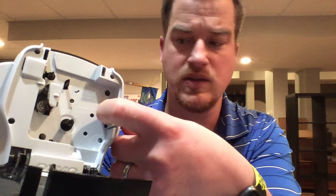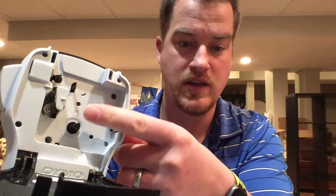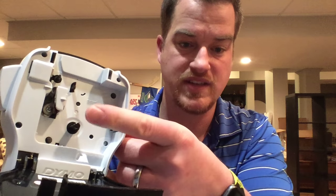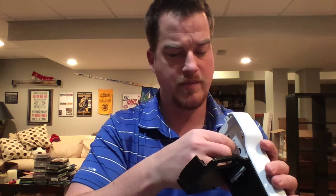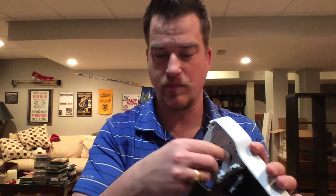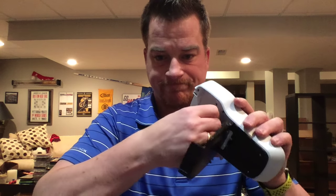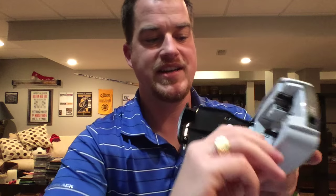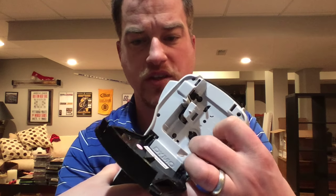Once you press it with the batteries in, you don't actually need to turn it on. So you just press it. If I press this down, this should turn — every time I press it, it should turn a hair. So if it doesn't turn, what you do next is take your hand on the spindle. You turn it clockwise five times, and it's really hard. If you need a pair of pliers, gently turn it, but I recommend using your finger because you don't want to damage the teeth on here. You physically turn it — you're not going to break it. You hear the motor in there kind of going. Turn it five times. When I touch the little tooth thing right here again, the spindle will turn.